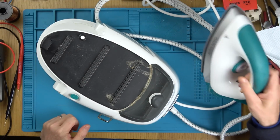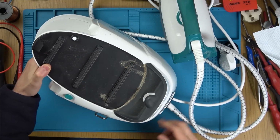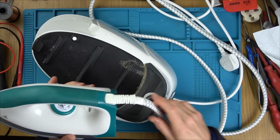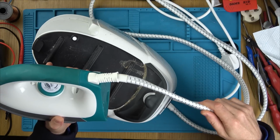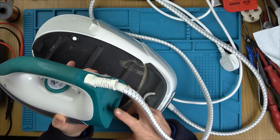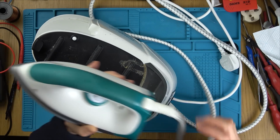I think pretty slim. And obviously power goes into the unit down here, but it's not coming up to here, I don't think. So let's start with this one here, and let's just see if we can get continuity maybe between the cables. I mean, it all looks brand new, so I don't think there is going to be a cable fault, but let's see if we have some sort of continuity between here and here, and then that might give us an idea of what's what.